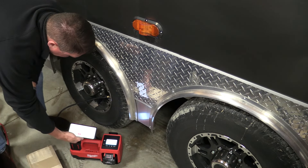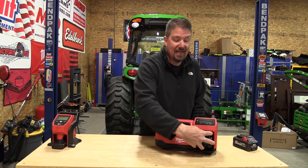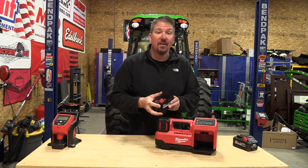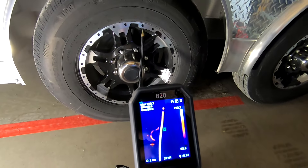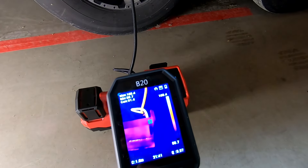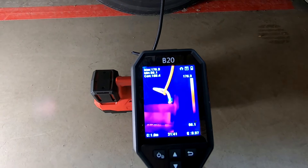Still very impressive. That would be three quarters of the duty cycle of the M12, and it's pretty amazing to see how fast this actually fills. We're using an eight amp hour battery and as we continued to fill, they got slower and slower. The last tire actually took closer to five minutes, but we were at the end of that battery, so it's understandable. It was also getting hotter, so we had the fan running on the inside, and we just wanted to check it for thermal issues that you could have with some of the other inflators.